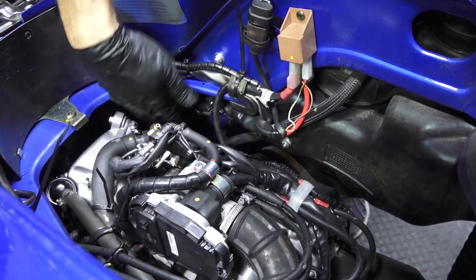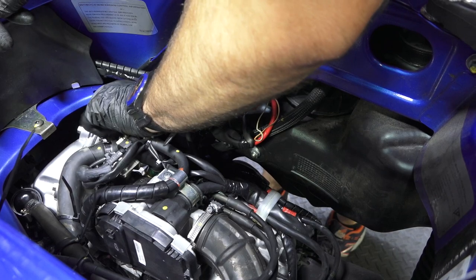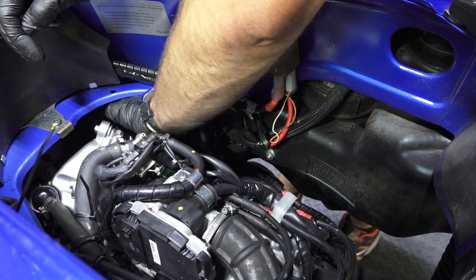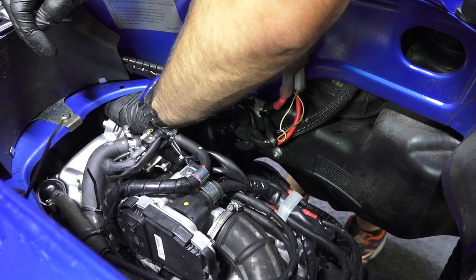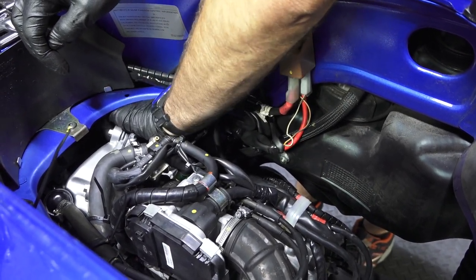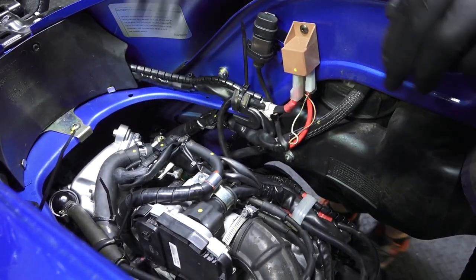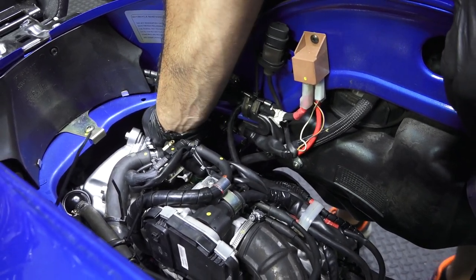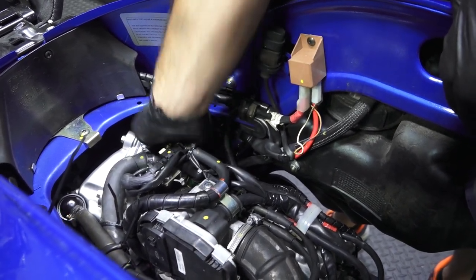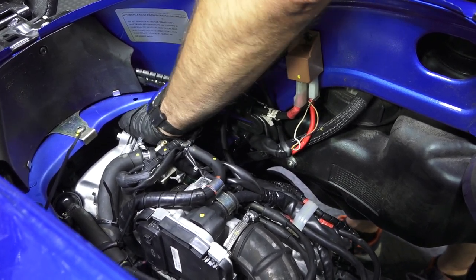Last thing you can do is you reach up, find the spark plug cap. Make sure the cap is tight. This is not the most fun job because you got to kind of reach around, find the electrode of the spark plug and get that on there. You have all the excitement, you get the motor in, get fluids filled, and you go to crank it and oops, spark plug's not connected. You get a ton of back EMI and RFI radiation from the spark plug cap not being connected. It's kind of dangerous to the electronics on the scooter to run these things without the cap connected.